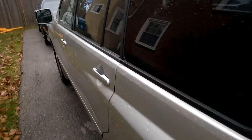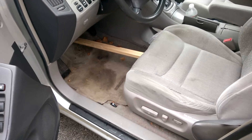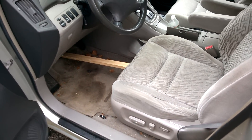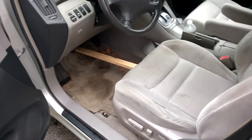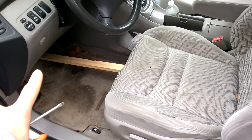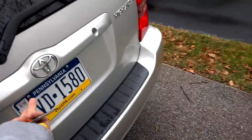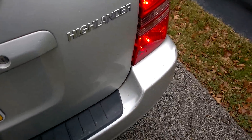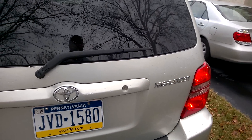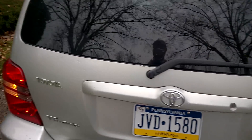That's not the problem. So if you're by yourself trying to fix this — I went online and there's a lot of people with this problem — someone said put a mirror behind the car, but that's a bunch of crap. Just get a piece of wood, pull your seat all the way back, put the wood on the brake pedal, and move your seat forward until it just presses the pedal down enough to turn the lights on. You'll have an automatic brake holder. You can see the turn signals work too.